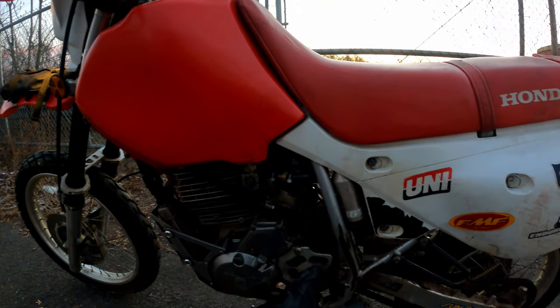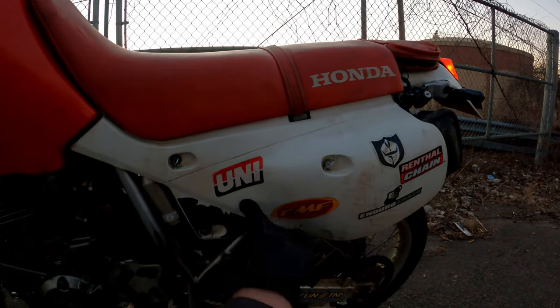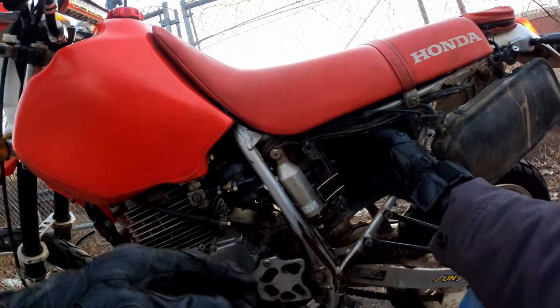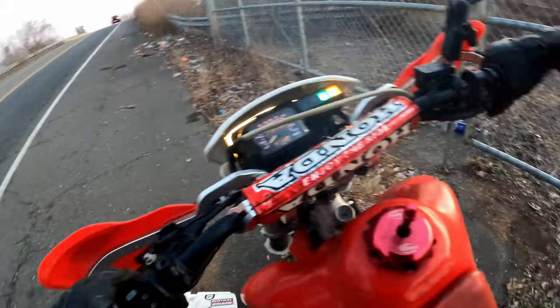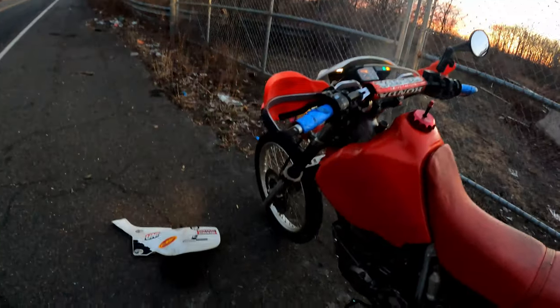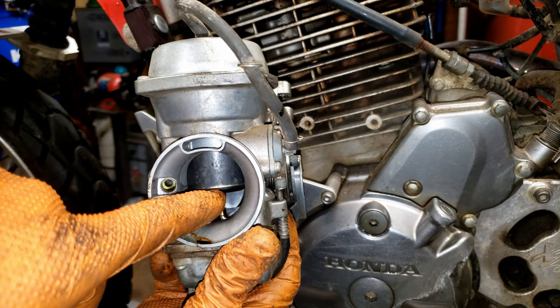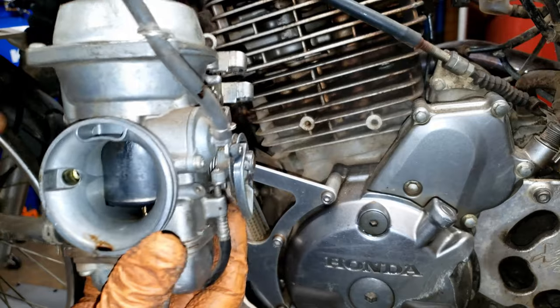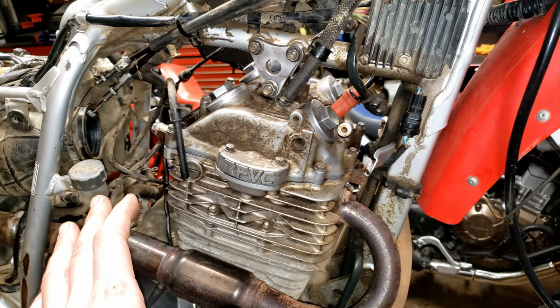No more engine noise, but it definitely needs the carb cleaned. I'm going to try one more time doing that rev trick where you cover the intake. It's nice on these XRs that you can conveniently get to the air filter. So you rev it up and cap it here. That carb's got to come off for sure. The choke is looking pretty crusty, and here's why she wouldn't rev up — it's a constant velocity carb, so when you rev it this floats up, and I can't even push it up higher than halfway with my finger unless I force it. Yeah, it's getting stuck in the middle. The inside isn't as bad but definitely smells like turpentine and has some green haze all over it. I'll get that cleaned up.